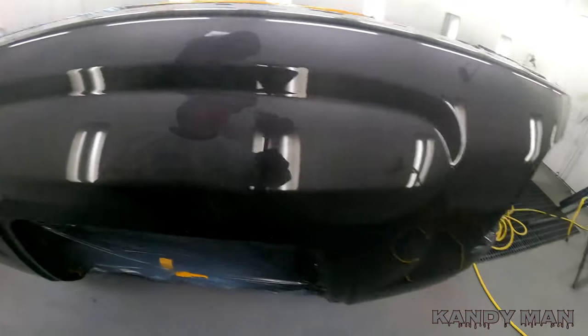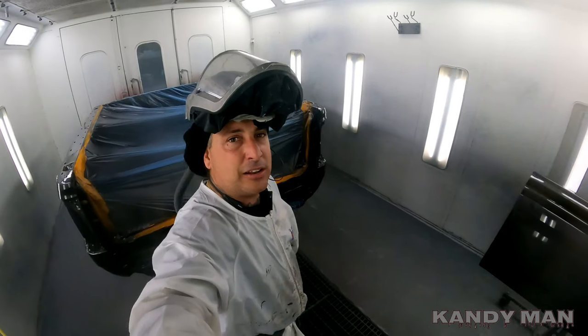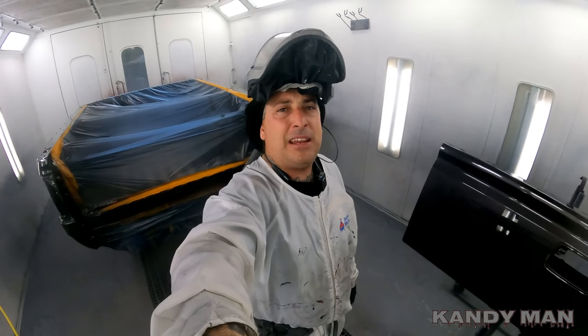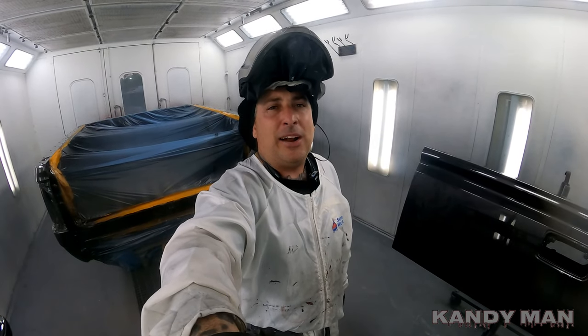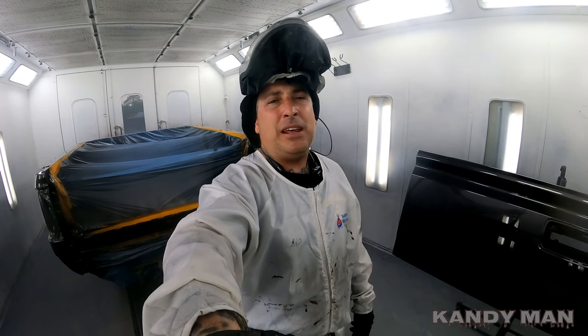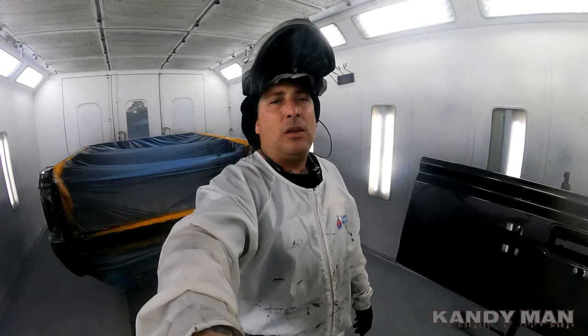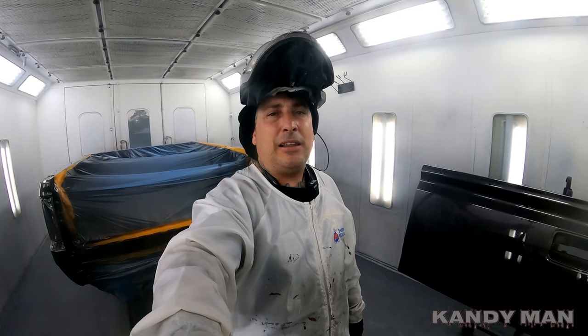So don't be afraid to try things out, guys. And when you're getting clear for the house, go for the medium solids. That way you've got something that kicks quick but still looks good. And also check into some spot clears because they air dry in 20 minutes. So if you're doing something small and you want to get through it quick and you don't want to have bugs land in it, go for a spot clear.